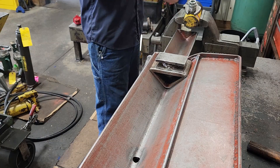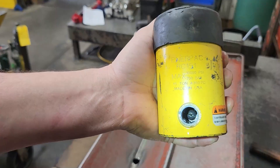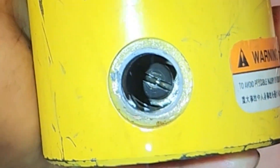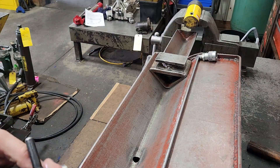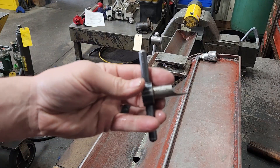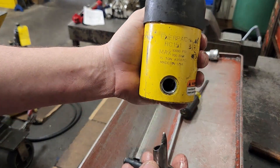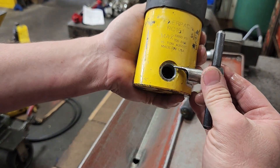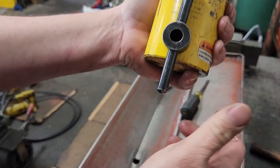To start, we're going to take this coupler out and drain the oil out of the cylinder. Inside there's a screw that we need to take out — it's holding spring tension on the rod. To remove it, we need this special tool and a standard screwdriver. This tool is going to go into the cylinder right here on the top side, into the top of the spring.